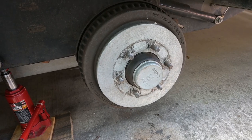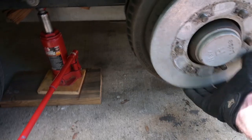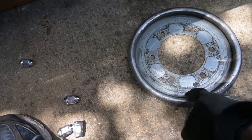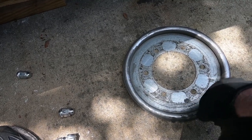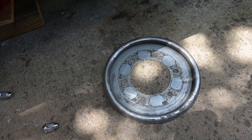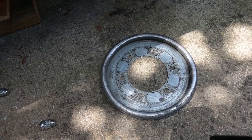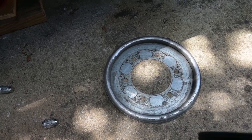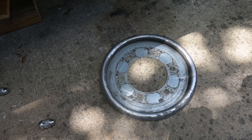Here's another thing I want to show you, which is the Centramatic wheel balancers. I have these on all four wheels. Basically, it's a steel tube with some liquid inside and some ball bearings. As your wheel rotates and vibrates up and down, those ball bearings move in a way that helps keep that wheel balanced. So in fact, your wheel is self-balancing: your wheel and your tire, your drum, everything. It balances everything while you're driving. It keeps it balanced all the time.